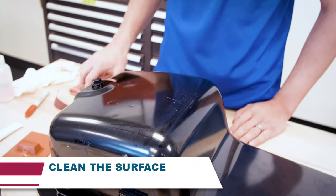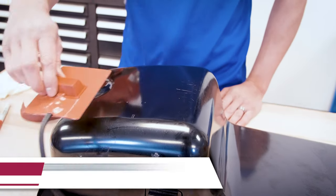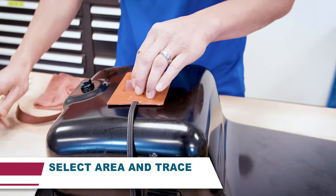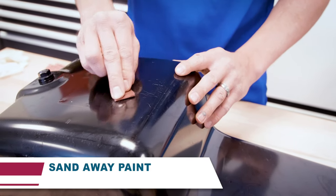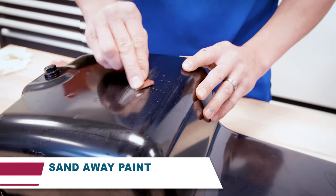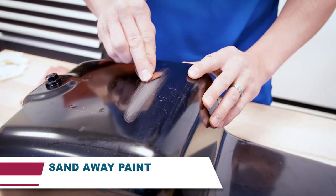Once you have selected the appropriate area for installation, clean the surface of any dirt, grease, or oil. Position the silicone pad on the metal pan and trace the outline. Remove the paint from the installation site using sandpaper, leaving the area scuffed, because a scuffed surface will allow better adhesion between the silicone pad and the surface.